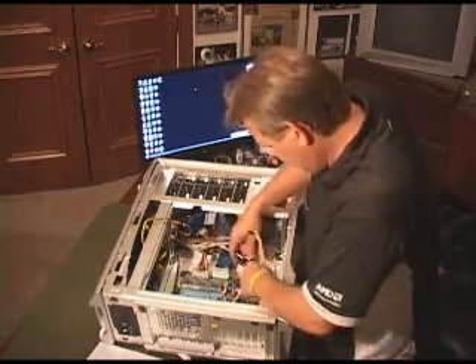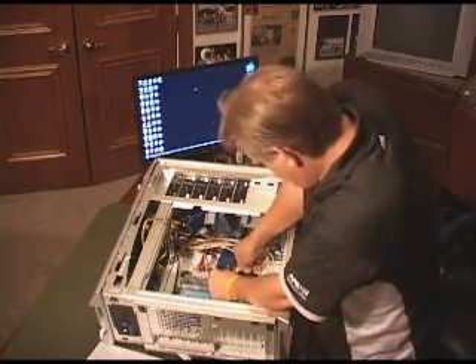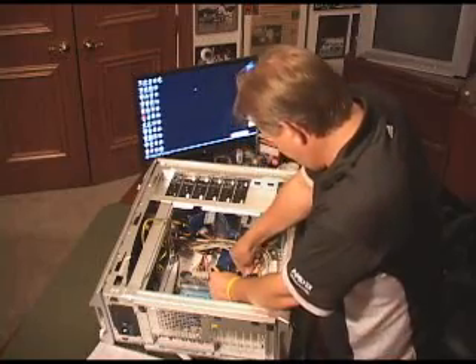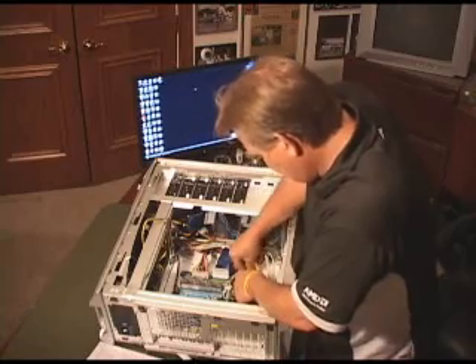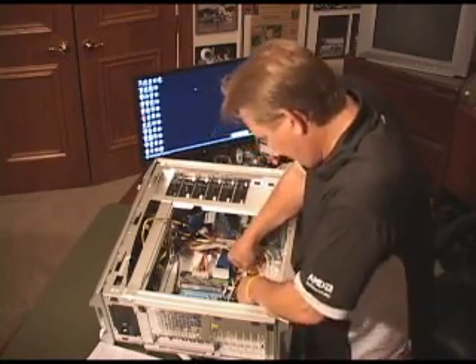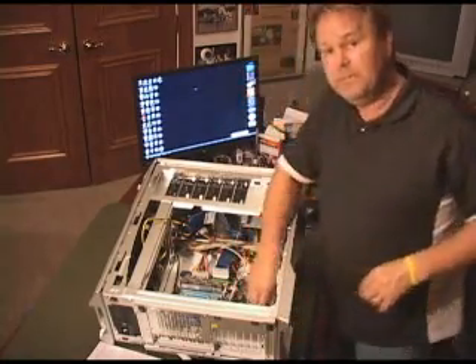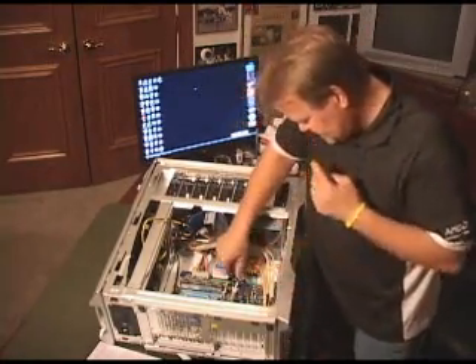And on these SATA plugs, just like I plugged in the one that's the SATA drive here, I'm just going to plug it into two additional ports, which are right next to that. And then I can actually — a lot of times you can do external drives and plug them into USB or FireWire, but this will actually give a little bit better performance for that drive.